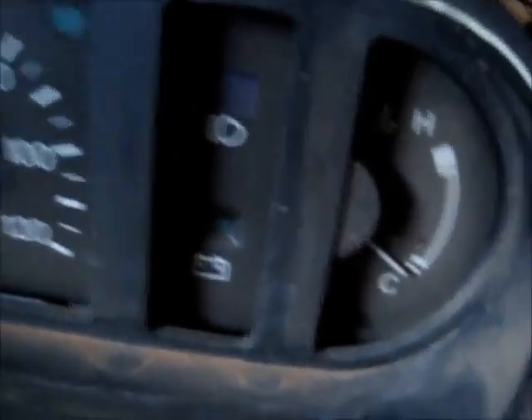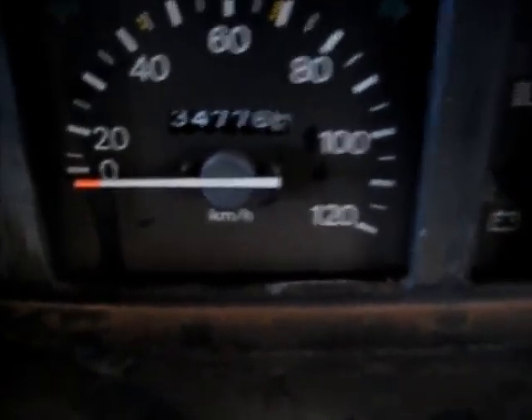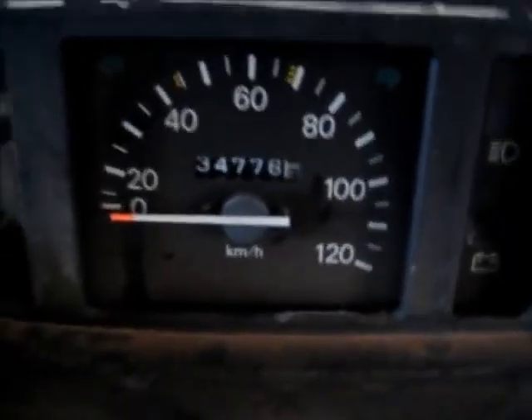You've got your battery warning lights, temperature gauge and fuel gauge — pretty basic stuff. You've got your lights, warning lights, dash cluster lights. Seven-volt ignition, earth, your fuel gauge there, temperature, and the seven-volt signal to these gauges. And there's the drive for the odometer and the speedometer. There's a gear that drives that, kind of like your electric meters have. So I'll carefully pull it apart and show you how it works. I'll get the VN Commodore one out and pull it apart also, and show you the difference between the modern and these older ones.